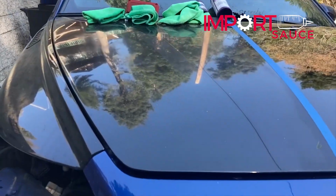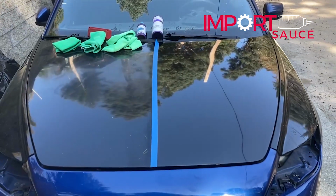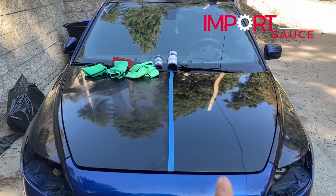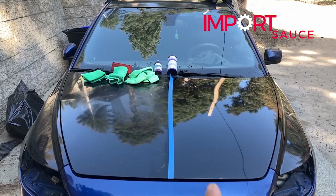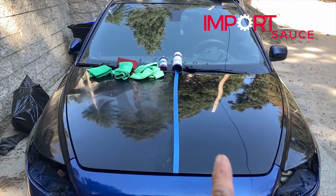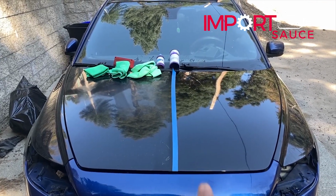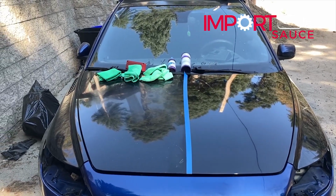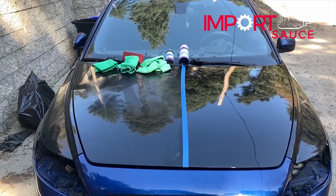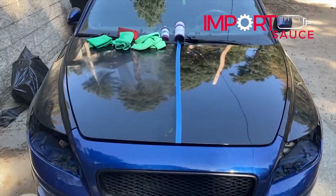Looking pretty good, right? Down here versus, look at that. Untreated junkyard hood, two stages in. So we got clay bar, a little bit of correction with wet sand on the clear coat, rubbing compound stage one, machine polish stage two. I think we're ready to move to stage three, which will be the ultra fine machine polish. So same thing, we're gonna get some fresh rags and just go at it.